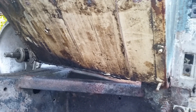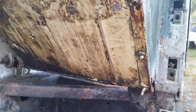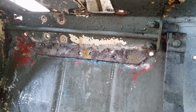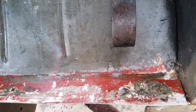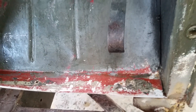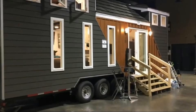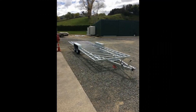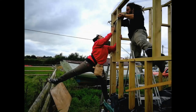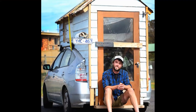I did what sandblasting I could with some sand that I scraped up from the driveway and sieved, but it's blunt. Once sand's been used through a sandblaster, it doesn't have the sharp edges to do its job anymore. So all I managed was to get the worst of the rust off these little corners so I could have a look, and blow some of that underseal off on this double stiffener thickness thing up here. So now I'm going to do a little bit of gardening.